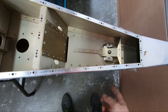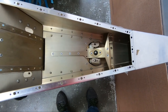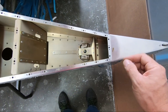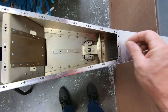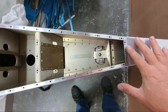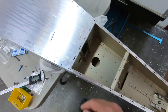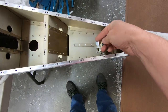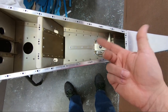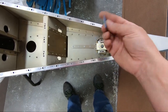Once this is done, I should be able to go ahead and secure the rudder and finish the rudder fit, get the nut on the back, and get the rudder horn attached. Just trying to finish up all this stuff underneath the fuselage while it's accessible. I was able to get all the nut plates installed with the rivets in place. I went ahead and drilled out the holes for these number 4 bolts, and I just got done cutting out the little washer shim that's supposed to go on top of the aft bar for the vertical fin.